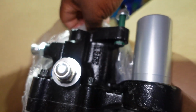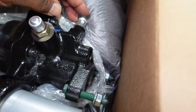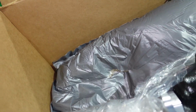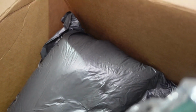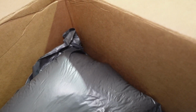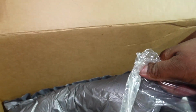Now, if you look at this, I'm gonna tell you, this Hydroboost unit doesn't look like anything but a unit for like a Chevy Tahoe or Suburban or a Chevy pickup. But what the difference is, which is supposed to make it easier to mount, is I've put plenty of Hydroboost on, and I would just use like Chevy truck ones. But getting it to mount correctly to the firewall is always an issue. And then getting it clocked just becomes a little bit more difficult. So I'm gonna show you what I believe they've done to where it's supposed to be kind of a direct bolt on.